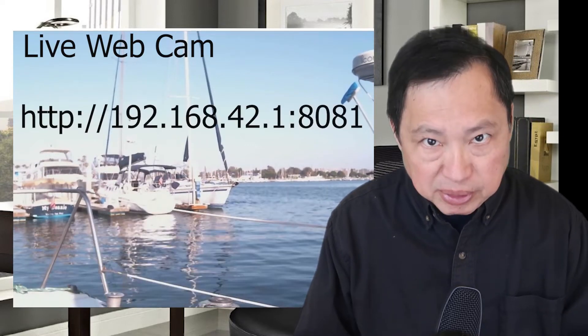There's no login required to connect to the cameras. To use the system I just connect to the Wi-Fi, which I call mesh Wi-Fi. Then I put in the URL of each of the stations in a browser. They are both assigned a fixed IP address which I'm able to monitor directly on the Ubiquiti modems. I just put in the URL using the IP address of each device and the port number, and I can see the live stream. The Wi-Fi connection requires a password of course, but the traffic between the stations does not go through the internet, so it's private.